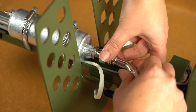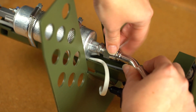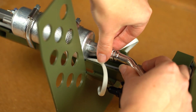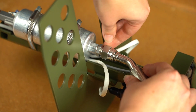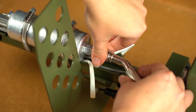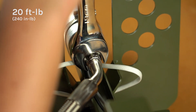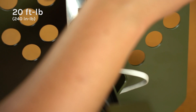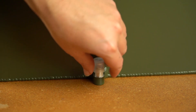Take the 45-degree hose end and thread it onto the fitting as straight as possible. If it's not going on smoothly, it's not aligned properly. Firmly hold the male fitting installed in the fuel pump and tighten the hose end onto it using about 20 foot-pounds, which is three times as much torque as used to install the fitting into the fuel pump. It's very important to hold the fitting during installation and removal so you don't end up applying that high torque to the pump threads too.